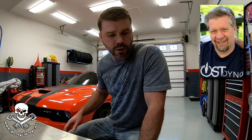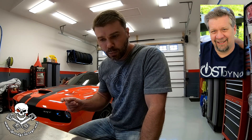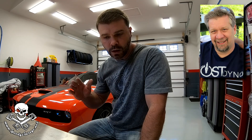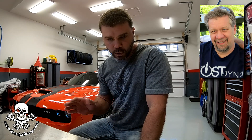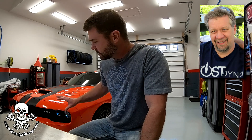So you look at knock sensors and you look at timing and the way we did Orange Crush, we basically took all the timing out until we got the fueling dialed in. And then we sneak up on it — you'd add a little bit, add a little bit, add a little bit until the knock sensors kind of started to talk some, and then you would adjust it back down until we had just enough knock sensor feedback that we knew they were working and that everything was nice and safe and happy. Is that the kind of similar format that you use for the Hellcats or is it because the computer systems are so different?